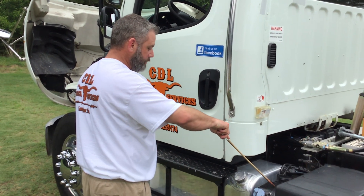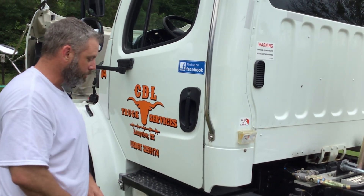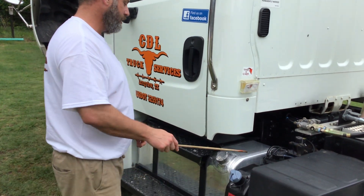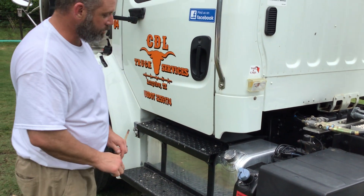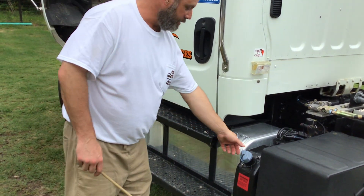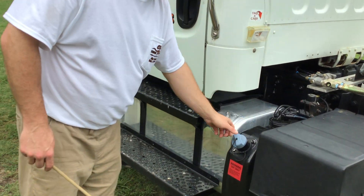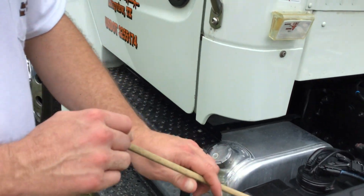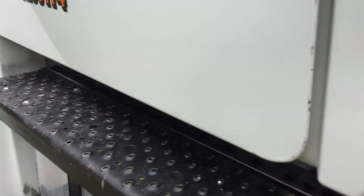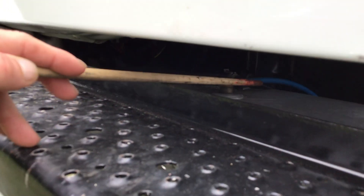This is my DEF system. My DEF system is properly mounted and secured. All nuts and bolts are present and tight. It's not cracked, bent, or broken, and it's not leaking. All hoses leading to and from it have no abrasions, bulges, or cuts. All fittings are present and tight, and they're not leaking. My cap is present and tight. My rubber seal has no abrasions, bulges, or cuts, and it's not leaking. These are the fuel hoses — all fittings are present and tight, and they're not leaking.